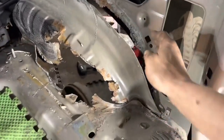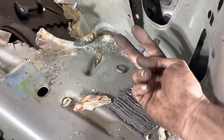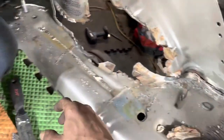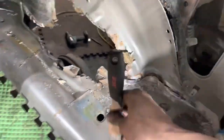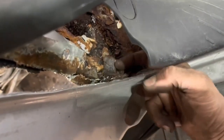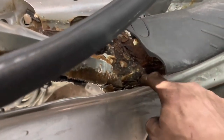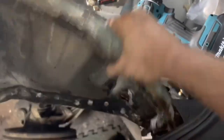We've got our panel free. When you go through this way you have to go through two pieces of metal — this piece and this piece — but it's also affixed to this piece, so we use the spot weld remover chisel to get it behind there and break them free. Same thing down here: we've got three pieces of metal — one on top, the panel in the middle, and then it's affixed to this panel right here — so we have to use the spot weld chisel to push down inside there and free it up.